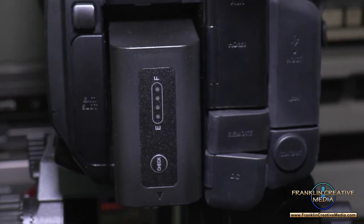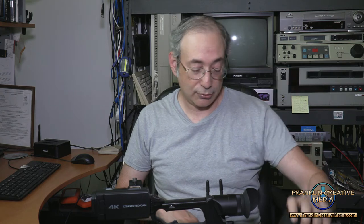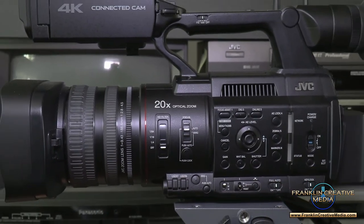One thing I liked about this camera, despite its size and capabilities, is that it really did well with batteries. They're large batteries, but they really lasted a long time. This is their largest — it's got a built-in power meter on it. This one lasted in the camera over three hours, which is great. The GY-HC550 is a 7.2-volt camera. Despite its large size, I was surprised to find it's only 7.2 volts. When I use the XF705, I don't think I've ever gotten two hours on a single battery — the XF705 is a bit power hungry. Most you're going to get out of the XF705 is about 110 minutes.